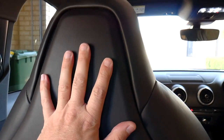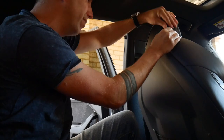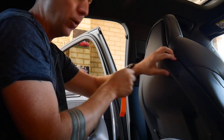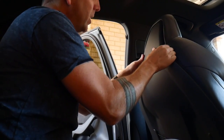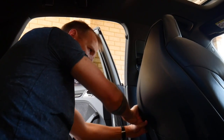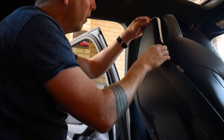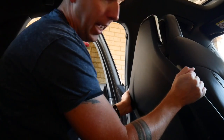So as best I can I'm going to try and show you how to remove the seat backs of an RS3. Apparently these top sections just fold out - I think what might work here is a trim removal tool. Change of plan, we're going to try and pop these clips out first. That's one, that's two, there's another one, that's four - we're getting there. And I think now it just lifts up, give it a wriggle - okay, that's one side.